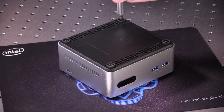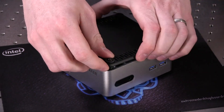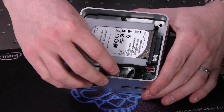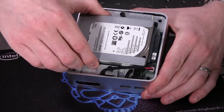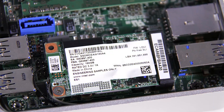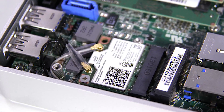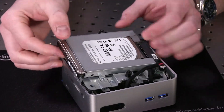The real change is what you see on the inside. When you open up this NUC, which opens the same way as the previous generation, you'll find a new bracket inside — a new capability to store a two and a half inch hard drive that takes advantage of the SATA power and SATA data connections that were kind of a mystery on the motherboard before. You still have access to an mSATA storage solution and an mPCIe for wireless connectivity. So you can use a 120GB mSATA drive for your primary OS and then add a one terabyte two and a half inch drive, or use a lower cost two and a half inch SSD.